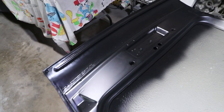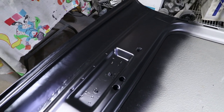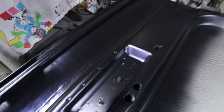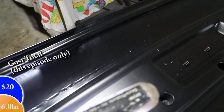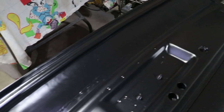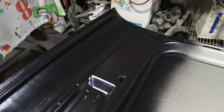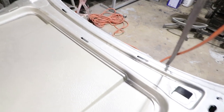And then this is the underside of the hood, and this piece is homemade. This is an extension added onto the short hood. So this is handmade, it's got a lot of hammer marks in it. This needs to have a skim coat of filler and then sanded smooth so it looks smooth like the rest of the hood. And then this portion of the hood is just going to get a light sand and just paint right over this existing paint.